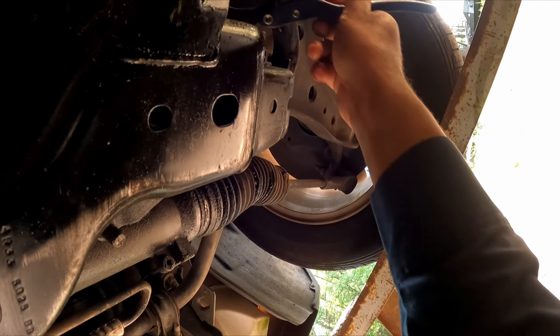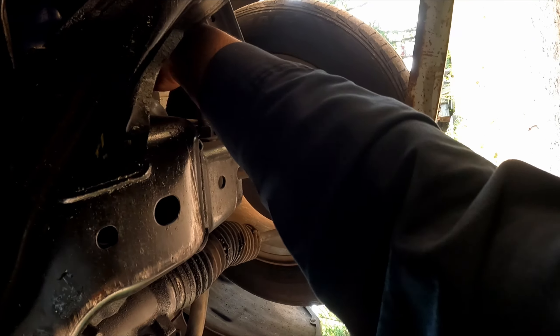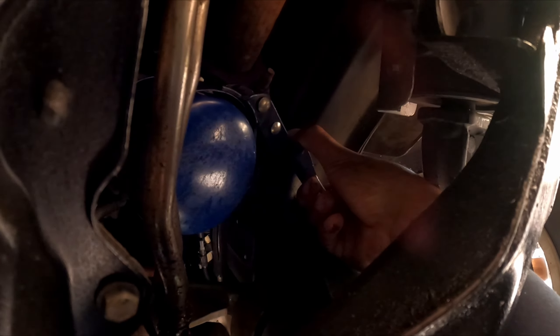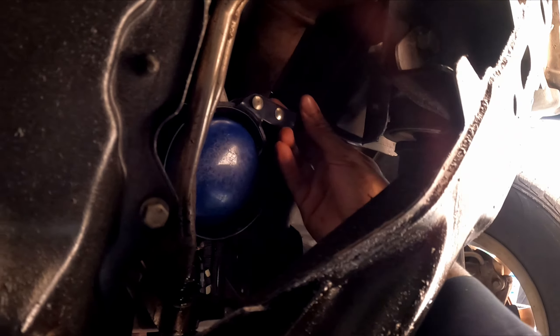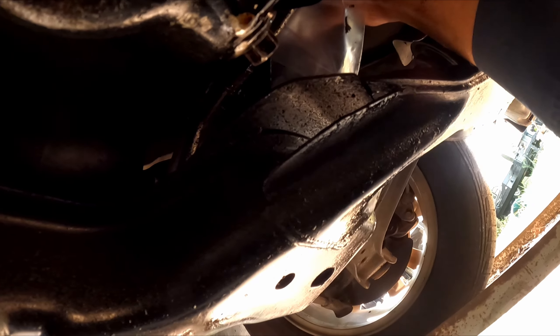The filter was a little stuck so I used a filter wrench to break it loose — barely any room to work with, but it moved. All you really need to do is get it to move just a little bit with the wrench. Once it's loose, I came in with the bag pressed over it to catch any oil that spills out.